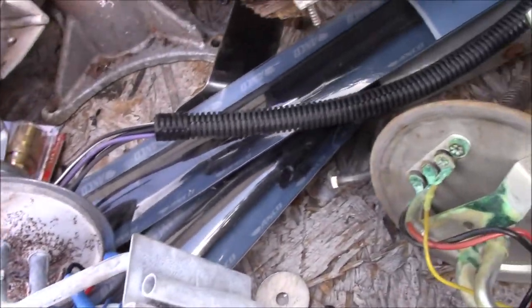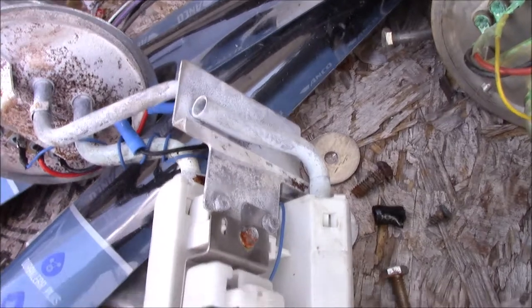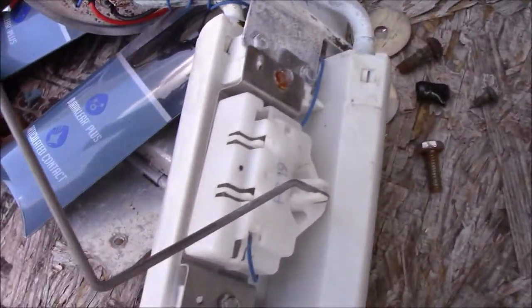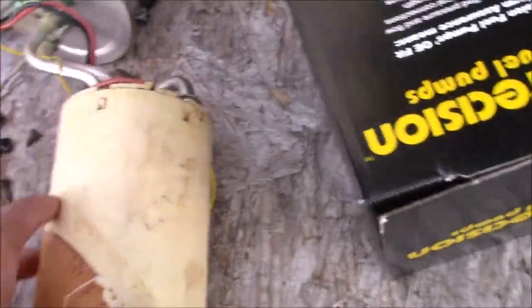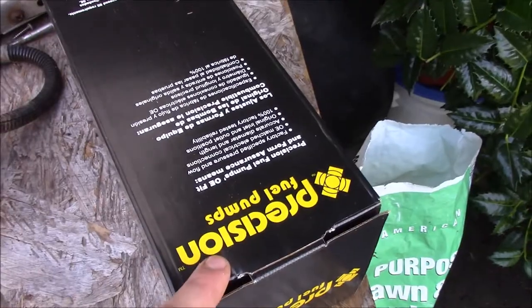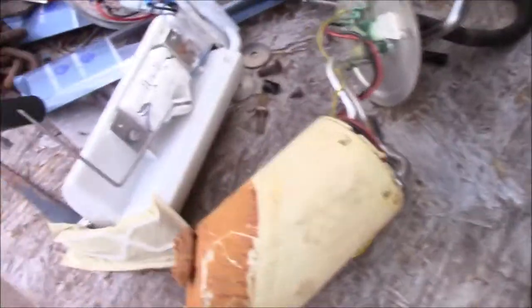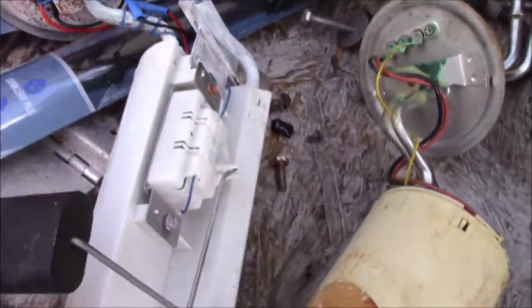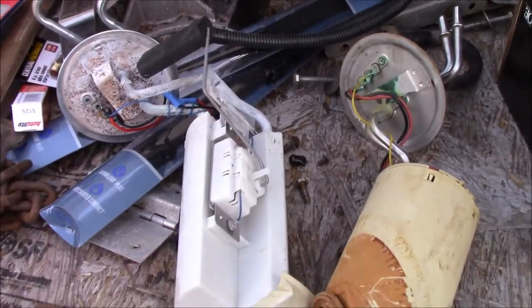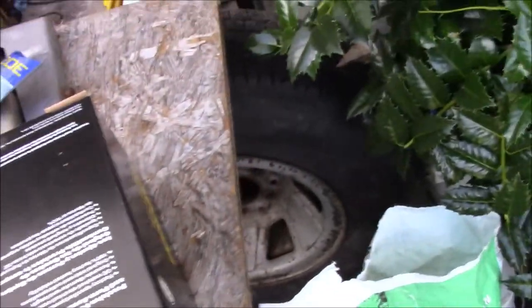This thing was apparently more water than gas. My theory — I might be wrong — is that us running it like we did, trying to get all that old crap out, I think we tore up this new fuel pump in the process and now it's useless. So we're going to be popping a new pump on this one, keeping the old housing, disassembling this one. This is a precision fuel pump, which means it is lifetime warrantied — if it goes out again, we can just take it back to the store. I'm pretty sure I lost the receipt though, so I may just have to eat the cost.